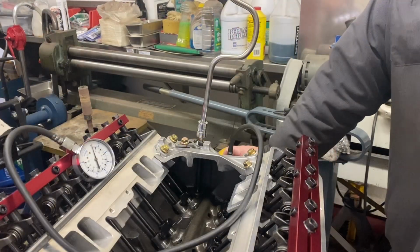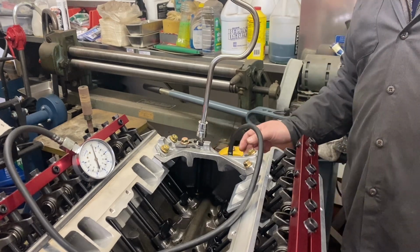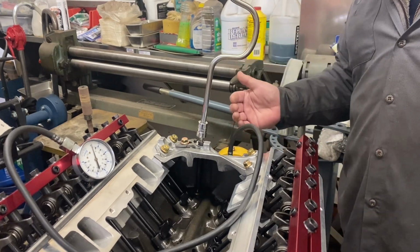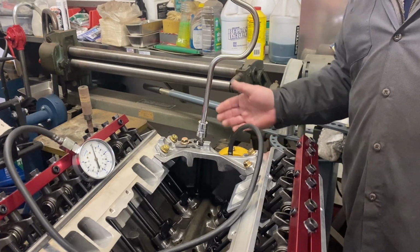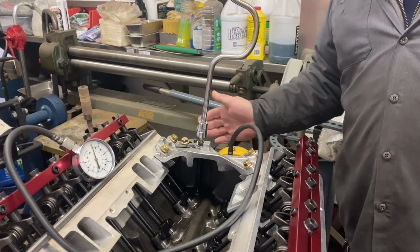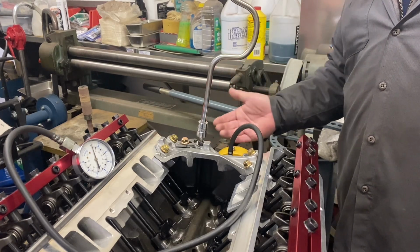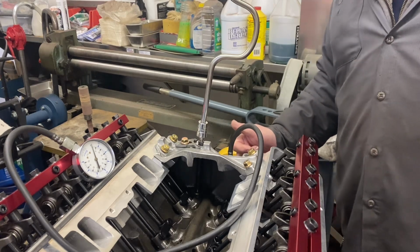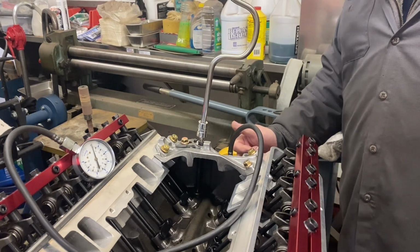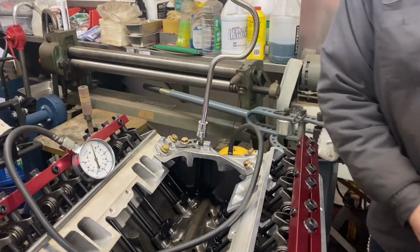I had originally bought Lucas 30 weight break-in oil when I was going to assemble this engine with a flat tappet camshaft. And it's still relevant, even though I don't have to break in my camshaft. One, it's used, and two, it's a roller. But I have it, so I went ahead and put 5-ish quarts of that in, dumped it in yesterday, and I finished off the bottle of EOS.